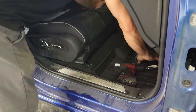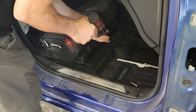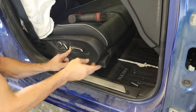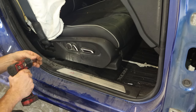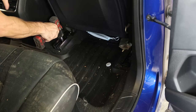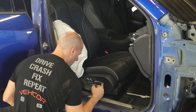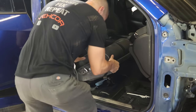Now we're going to pull our passenger seat out of here. Pull the little caps off so you can see the bolts — and we've got the wrong socket. Get the right socket. Put our seat forward — the airbag took that little piece off for us so that we can see our nut that holds our seat belt on. The seat belt is still good, go figure. Unbolt our rear seat belt, make sure our seat is disconnected, pull our headrest out of there, put our seat back and center it over the track so it's easier to store, and tip it back. Builds pay for themselves.